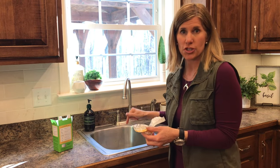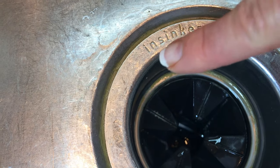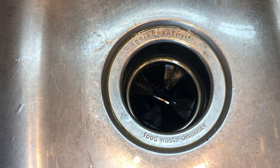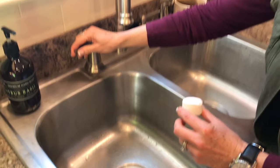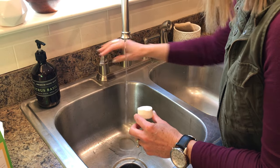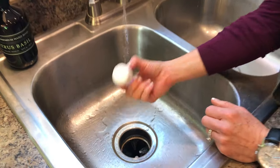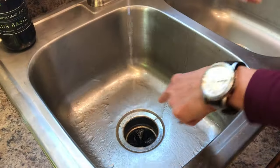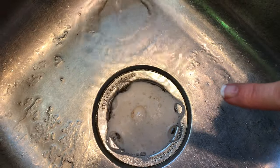Okay, now let's clean the garbage disposal. You know how the smells get yucky or stuff can get in there — it's important to get it cleaned out. You can see the dirt and crud down in here; all of that is going to be cleaned up with this disposal cleaner. It is amazing how quickly and how well it works. So take your tablet — here's the trick: turn your water on to a low flow and make sure the water is already hot. Also make sure your garbage disposal is already cleared out, so run it beforehand if you need to. Put the foaming tab down inside and with the low flow going, turn on the garbage disposal for 15 to 30 seconds. You see the foam coming up now? Keep it on until the foam goes back down.